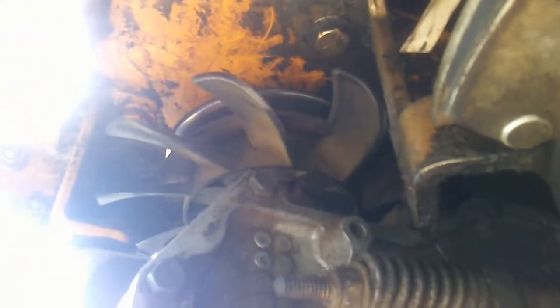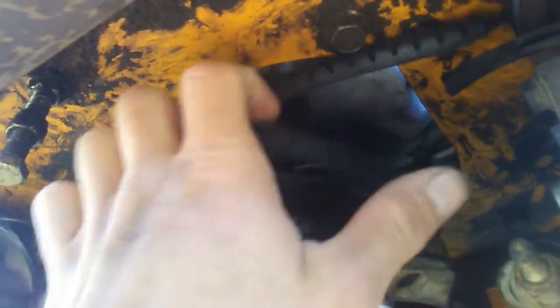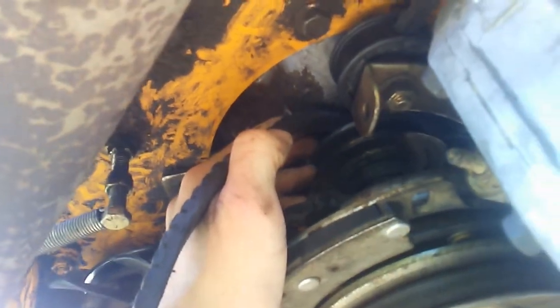As you can see here, that's one pulley with the fan on it, and the same thing on the other side. The drive belt stretches from that and across this pulley here. The problem is that the engine was running when the drive belt broke, so it got sucked under this pulley and it's hard to pop it out. I'm trying to pop it off of this pulley right here that it's attached to.